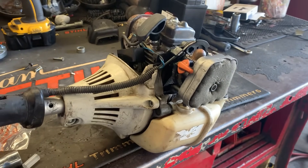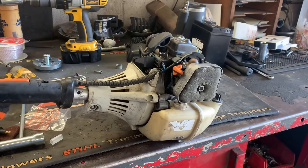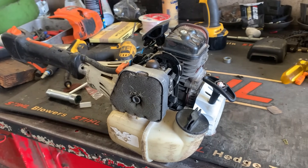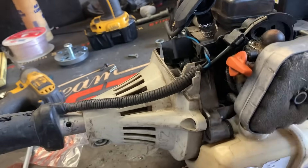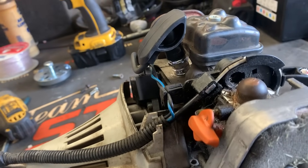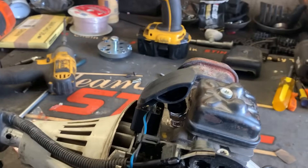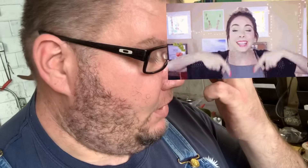The trimmer runs good. The last thing you can do is a quick and dirty diagnostic — what we call a diagnostic in a bottle. Take a little bit of brake clean, carb spray, or even just a little mixed gas and dribble it straight into the carburetor. If you pull it and it doesn't fire off on the fuel you've introduced, then you could possibly be looking at a coil issue. Most of the time it's just going to be a spark plug. If this content helped you out, give me a thumbs up and smash that subscribe button. Click that bell so you get all my new videos. Y'all have a good rest of your day.